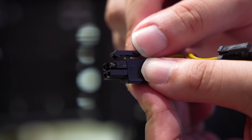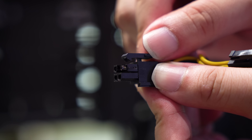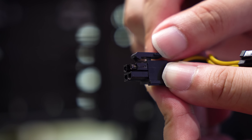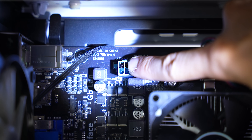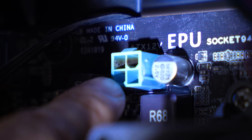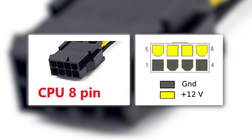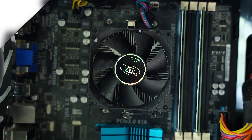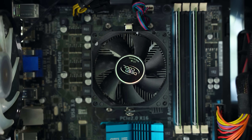Raymond — very quickly and astutely, I'm really glad he's here because I definitely would have missed this — noticed that the 8-pin EPS connector is actually chipped. The board actually only supports a 4-pin for CPU power, but you can see where there's a piece of plastic that's missing. It looks like it might have broken off inside of the connector. In this top left hole, there's a piece of plastic chipped off inside. But if we look even closer, we can actually see burn marks inside these top two holes. Those top two are the 12-volt leads and the bottom two are ground — and sure enough, from the pinout, the top two in yellow are, in fact, the 12-volt leads. What I expect happened here is we had some sort of small power surge that partially melted the connector and likely affected the CPU and the motherboard as well. Anytime you have burn marks like this, it's never good for any of the products involved.